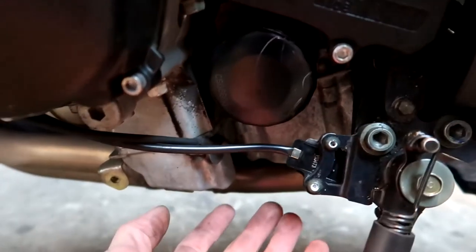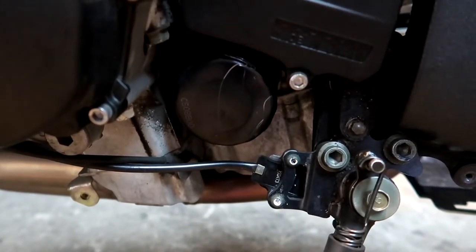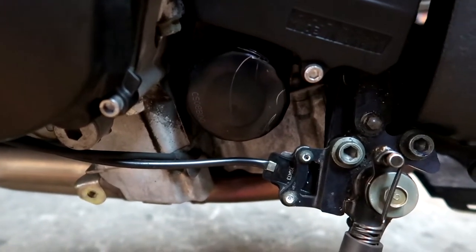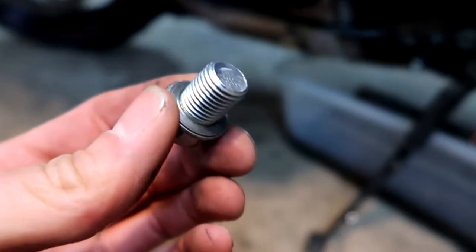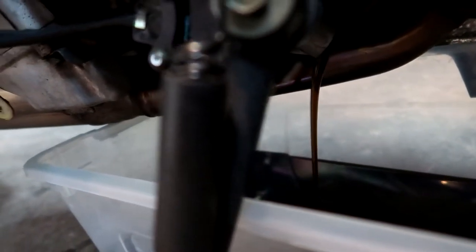Keep a pan underneath the filter while you're draining it because it will drip, of course, along with the pan for the drain bolt. I will be using a K&N 303 oil filter. K&N is nice because it has a nut right on it, because there's not really much room to get your hand around that, so having a nut on the filter will make it a lot easier next time. The drain bolt was a 17 millimeter on mine — if yours has an aftermarket drain plug it may be different. The crush washer: good practice says to replace it; I believe it's a 14 millimeter crush washer. Just let it drain until the oil stops coming out in a steady stream, then move on to the oil filter.